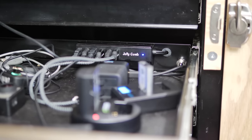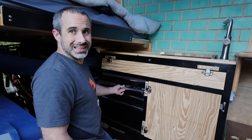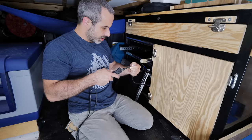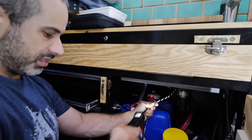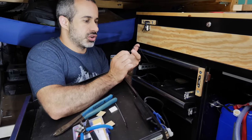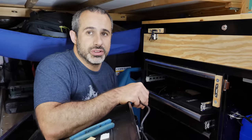We're also revisiting the camera battery recharging station. You've got to open the one below it first, because it pinches the cord. This took a beating. I've got power and no ground, so I think what we have is a bad ground. There's ground back here — we got that green light — but up here we've got no ground, so there's a broken connection somewhere. When a wire is easily kinked like this, it gets caught on things. With a big fat wire, it doesn't kink as easily. Let's install this and see if we have any resistance when pulling the drawer in and out.